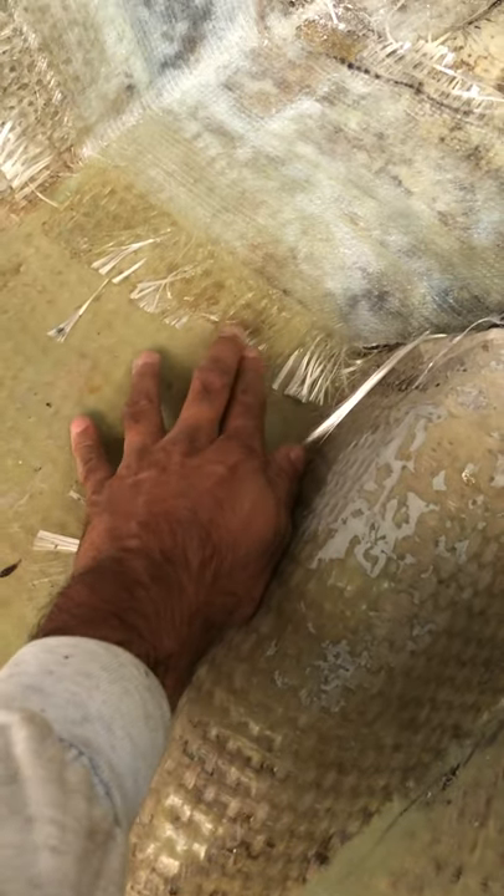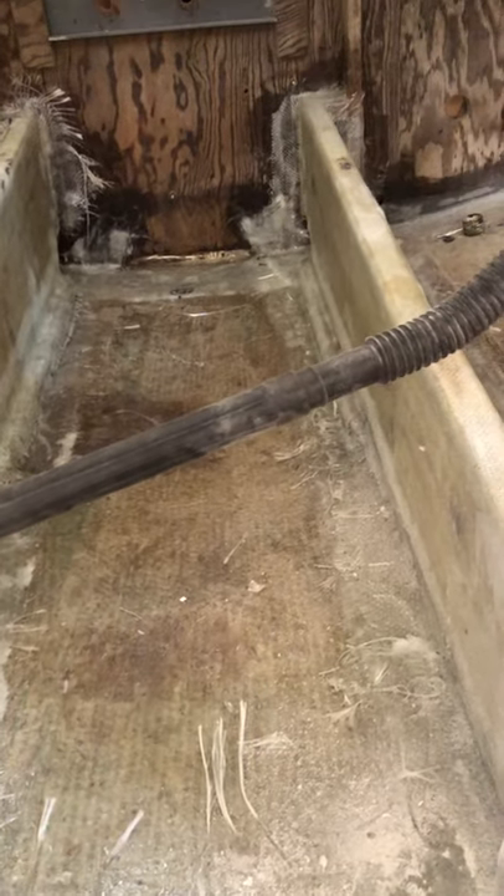Real world — we're not boat builders. We're just throwing fiberglass down, mixing epoxy, brushing it out, rolling it out. What I found is you don't necessarily have to wet out all the way to the edges. If it's getting out of your repair area, you can leave that frayed and come back and sand it off later. You're going to have to sand it anyway to get paint to stick, because the epoxy dries so slick — it has no tooth for paint to hold on to.